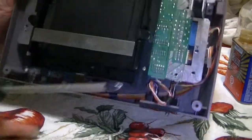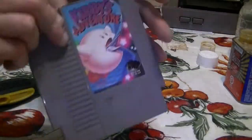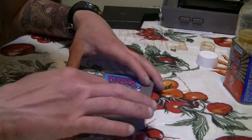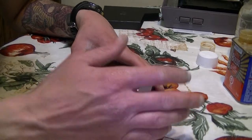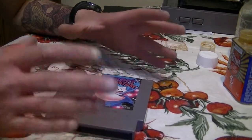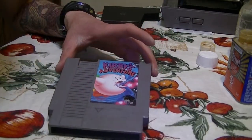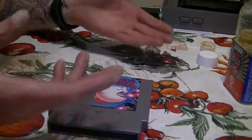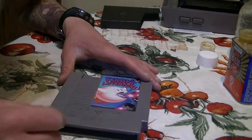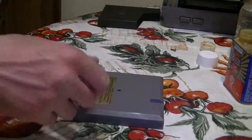Okay, so this is how I'm just gonna leave it for now. All right, my next part is showing you guys how to keep your games clean, because this is a big part. About 90% of the people that come back to me and say, hey, the system you sold me and fixed doesn't work, 90% of that is the games are not clean. They don't clean the games. I just put in a brand new 72 pin connector. I just cleaned this brand new 72 pin connector and you're sticking a dirty game back in it. You're gonna have the exact same problems like you did before. So be smart about this.